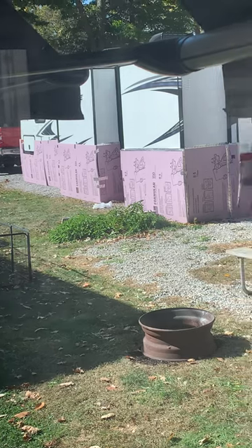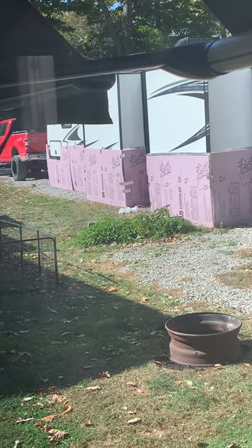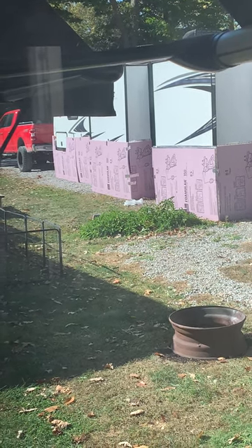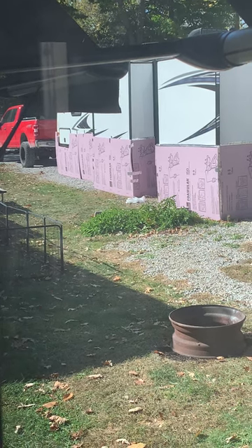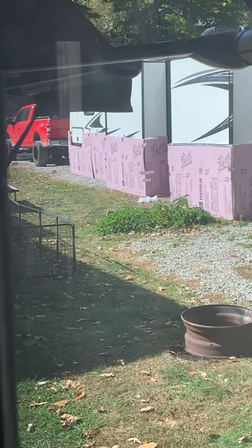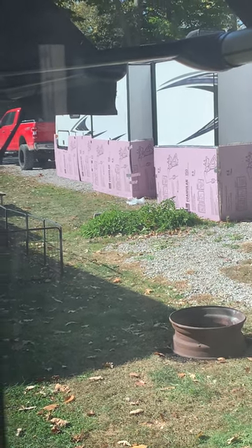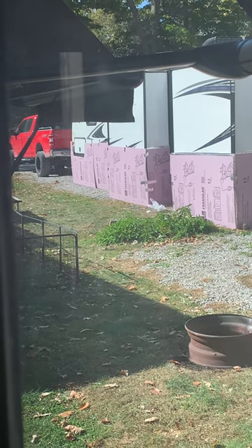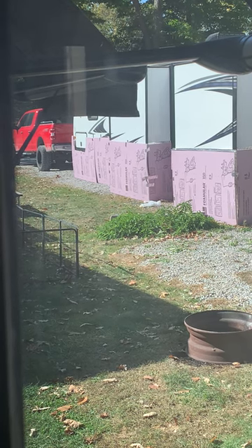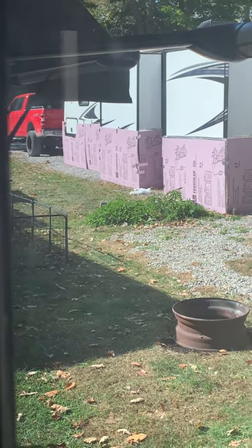A lot of space to heat up. The second thing is, once he seals that — and I'm sure he's going to seal it — the humidity is going to be atrocious. Like, you could literally put your hand inside there and it will come out soaking wet. Moisture is a trailer killer. So unless you put a couple of holes down there with a fan blowing some of that moisture out, your trailer's going to sweat. The floor is going to sweat. That's number two.